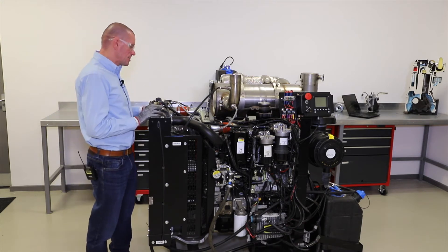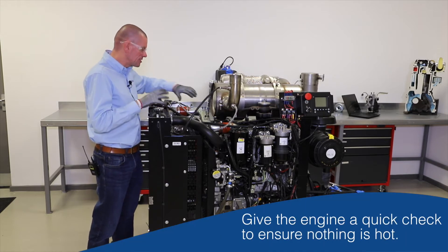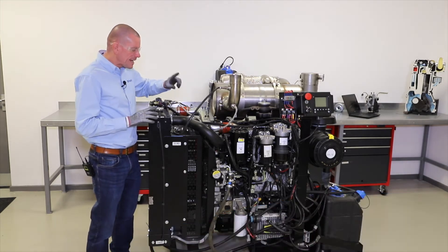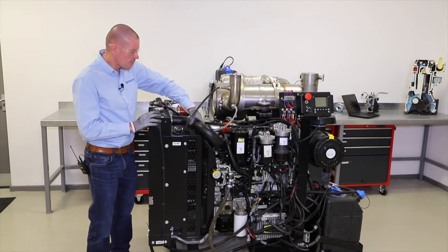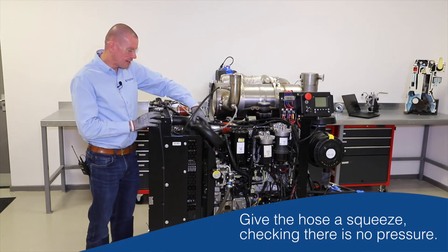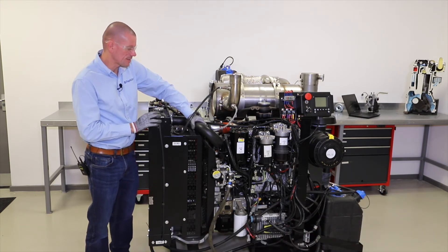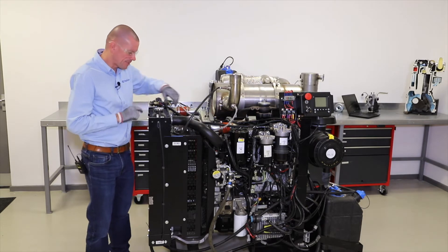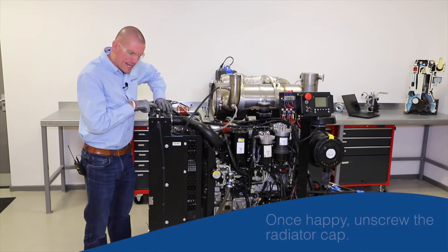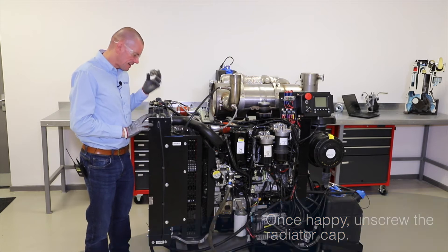As a technician, to check the engine is cool, I do a quick feel around — if there's no heat radiating from the engine and I touch a few components and they're not hot, that's a good sign. My main tip is to squeeze the top hose, the one that goes into the top of the radiator. You can actually feel there's no pressure in the system — that's a double check to make sure it's safe to undo the radiator cap. Very soft pipe, so I'm happy to undo this cap now — just a quick turn, no pressure, very happy.